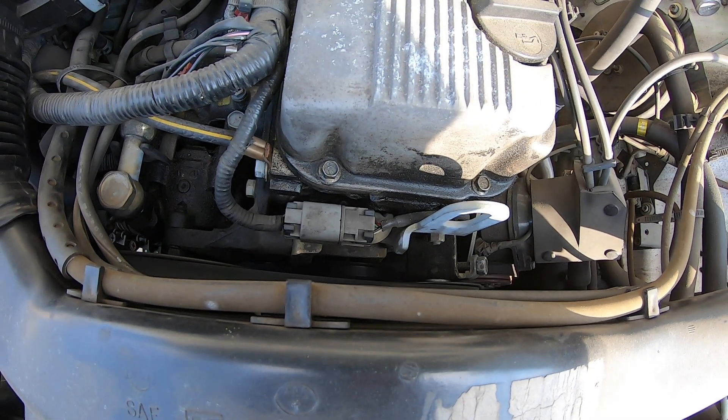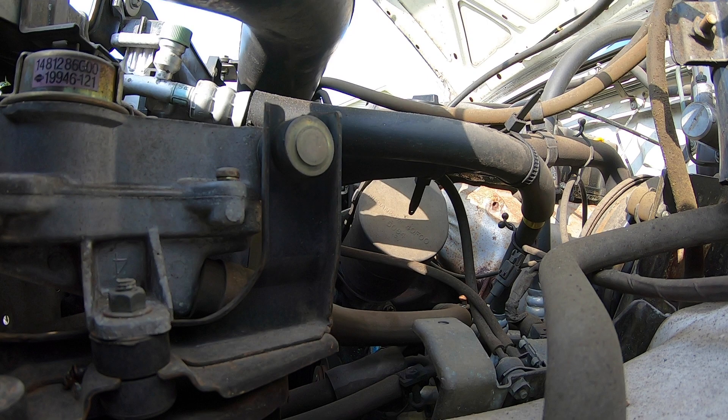With this truck being new to me, I thought that was the normal engine sound, but as you can hear there is a squeal or a whine. The reason I started looking into it is because that squeal got a lot louder when you turn on the AC.